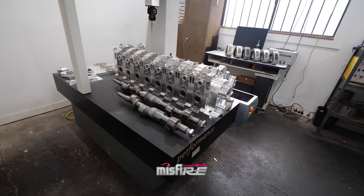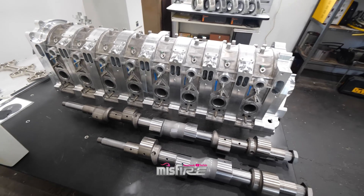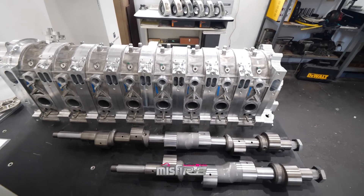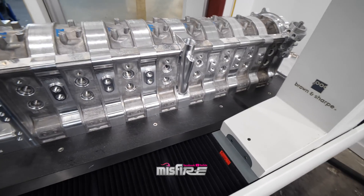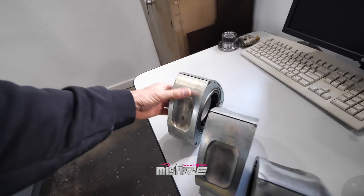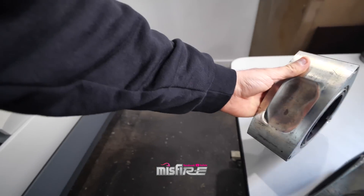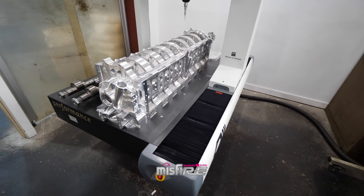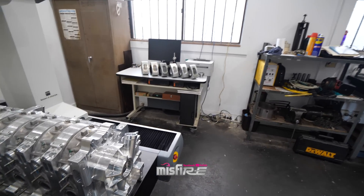Is this going to be the world's first eight rotor in a Tesla Model S that I'm building? It can fit — it is possible. I just spoke to an engineer. This is a four rotor e-shaft, a six rotor e-shaft, and I'm about to show you how it is possible to make an eight rotor shaft. This is all Billet Boss manufactured center plates and end plates. Now the issue with the rotors — here's a couple brand new ones. After speaking to the engineers, you can see they're gold, so they are brand new out of the box. For me to go eight rotor, it has to be NA — it's going to be an eight rotor peripheral port NA with those rotors, which are series four NA rotors.